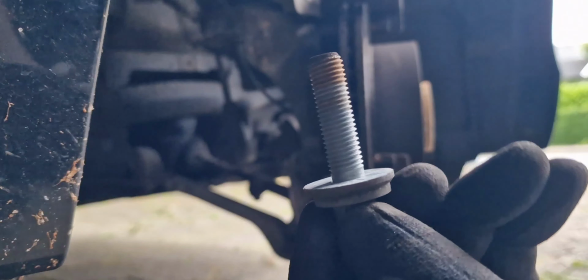The person who ordered the parts for me, I had asked also to buy the copper grease so that I will have to apply it here. It prevents it, the next time, from being tight the way it was today when I was trying to open it. It was really tight here because when metal and metal are in contact with each other for a longer period of time, more so when it's really hot, they tend to become one, you know, like super glue.